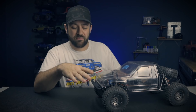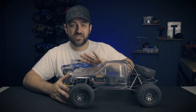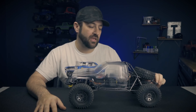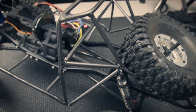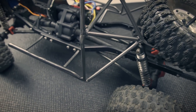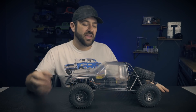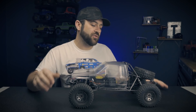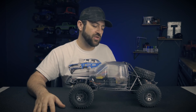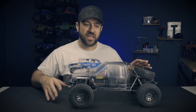Since the last episode I completely stripped the powder coating off the cage and repainted it with a gunmetal metallic wheel paint — kind of my favorite paint to use on cage work. You can get it at any auto parts store. Being that it's a wheel paint, it's a little more durable and it's got a nice heavy metallic flake in it. It can be a little temperamental — you've got to make sure you get it at the right distance and the right flow, otherwise it can get a coarse texture. But done right it looks great; it's basically my go-to for all my cages.